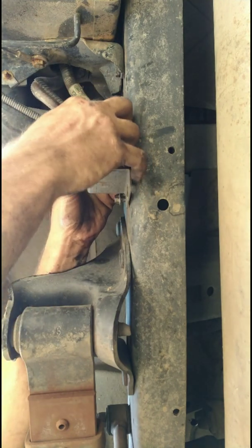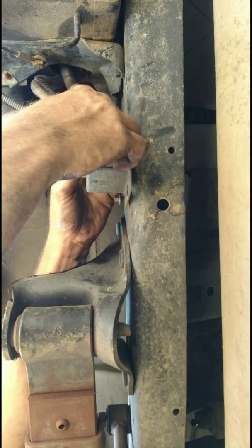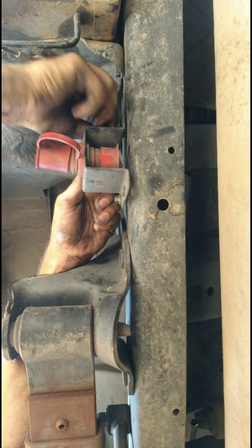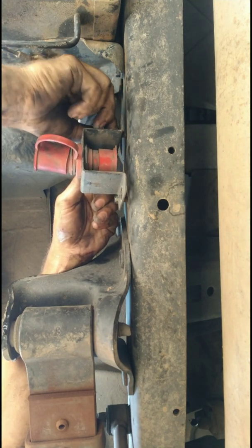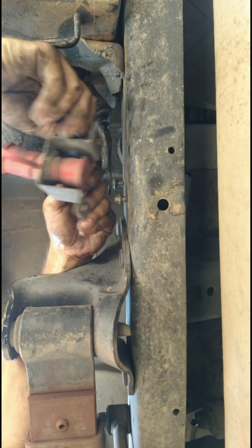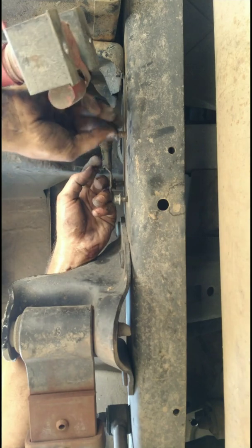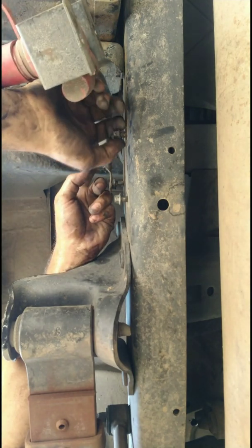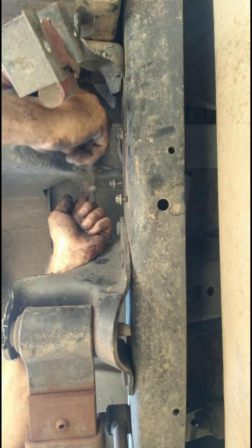Keep all the pressure off the bolt. That way you're just spinning the bolt and you're not hitting the threads on this bracket. So that's what my left hand is doing. It's holding the bracket up off of the bolt while I spin it out. Boom, that's disconnected. Are these self-taps? Nope, just bolts. I'm sure they wouldn't be, they drilled first. Anyway, let's screw these back in.